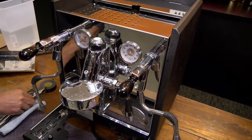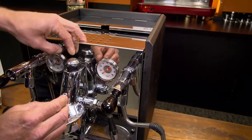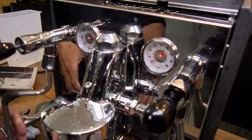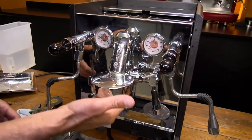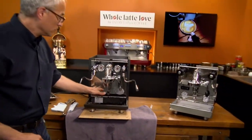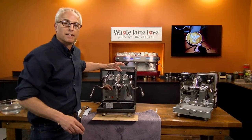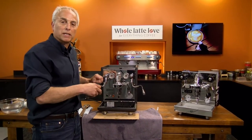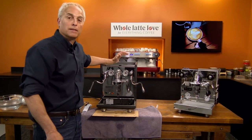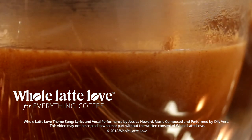Just snug that in there and take your tape off. You shouldn't have a problem with the sealing because there's a Teflon gasket in there, but after you next use the machine, fill the boiler up and put a back flush disc in your portafilter, raise the lever and pressurize it, and just double-check for a leak. If you have the new PIDs in these machines, you can set it to fill — go to the program mode so that next time the boiler will fill before the heating element gets energized. To see how to do that, watch one of our other videos on the PIDs and how to program it. So that's how you drain the boilers on the Pro 700 and the ECM Synchronica. Thanks for watching — subscribe now so you'll know about the latest videos on everything coffee from Whole Latte Love.